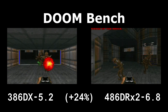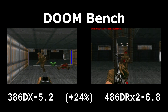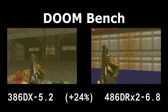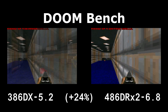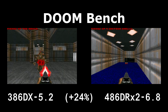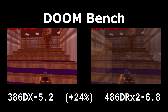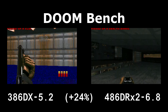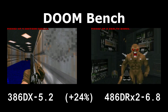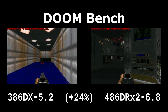This benchmark takes forever, so we'll go ahead while it's running and go over the different things that could potentially be the problem with that other motherboard. There were a few comments in the last video about how the power situation might be an issue, and there's some merit to that. The 386, while it's in high impedance mode when you activate the float pin, doesn't actually take the processor offline — the internal clocks and such are all still running. The processor still gets physically warm while it's in there. So it's possible that that motherboard is just not designed to have two chips running at once, and the DLC40 in it doesn't drag it down enough to cause a problem, but the DRX266 does.